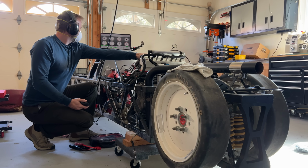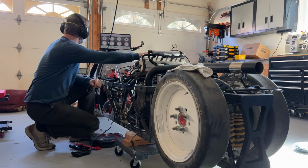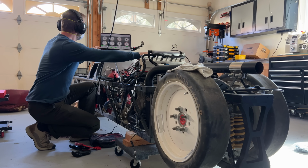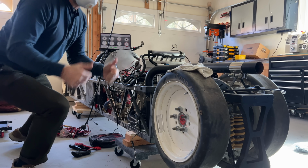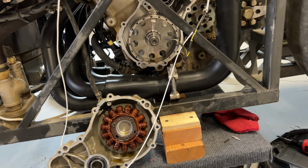With the garage doors closed, the new 12-tooth crankshaft trigger wheel, and the new Hall effect sensor, I gave it the beans. And I got back all the beans. Success! 14,300 RPM. It works. No need to do an offset crank sensor. No need to remove the generator and place in a new trigger wheel.